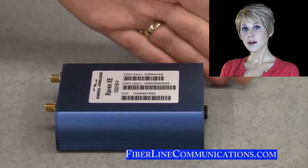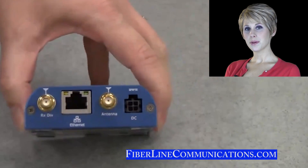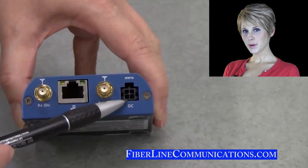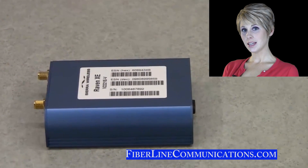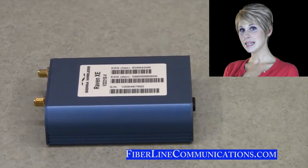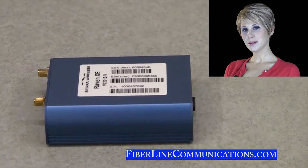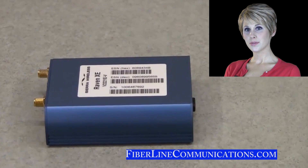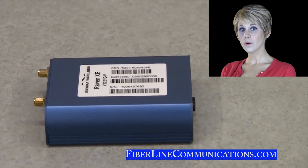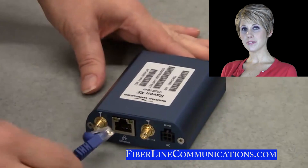As you can see, the modem is about 4 inches long and about 1 inch high. On the back of the modem is a plug for each antenna, a plug for the Ethernet cord, and for the power cord. To increase placement flexibility, you can use an electrical extension cord so that the modem does not need to be placed near an inconvenient location. You can also substitute a longer Ethernet cord so that the modem and antennas will not need to be placed inconveniently close to your computer or internal network router.